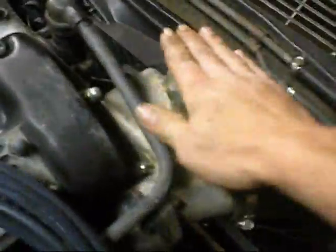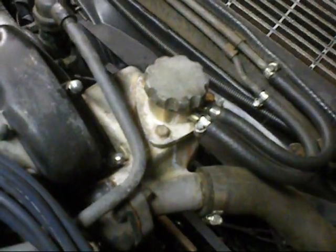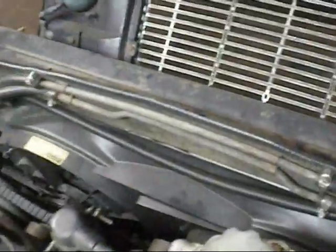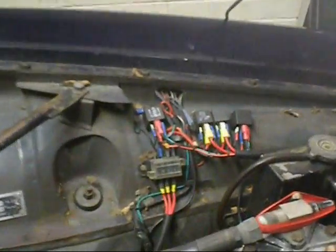It's got a handmade radiator cap, because normally you've got the flat cap on these that always leaks. It's got all new belts, AU Ford Falcon fan setup fitted. Good compressor, just needs hoses. Might as well put a new condenser on it and an auto-cooler. It's getting there — you can tell I've done the wiring.